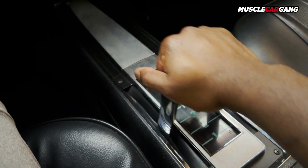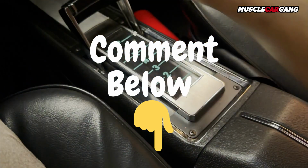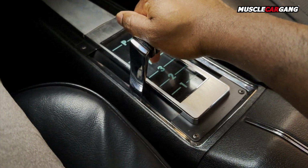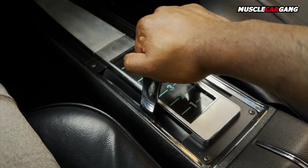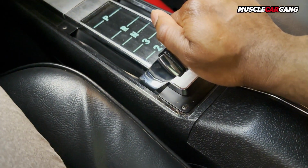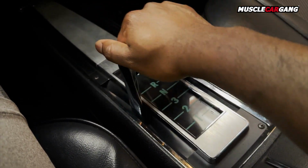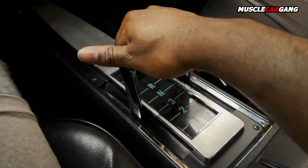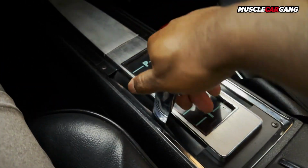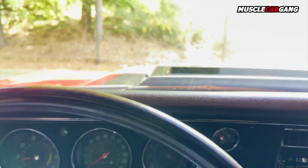Come on now. So if you ever had this problem, please comment below and let me know what you think it could be. Park works, reverse doesn't work. This is neutral, and neutral goes into reverse. I'm gonna drop it down, all the way down. All right, so it only goes when I drop it all the way down in one. So back to park, reverse. It doesn't go in reverse. That's a neutral. That's a neutral. And three goes in reverse. And one goes into drive.